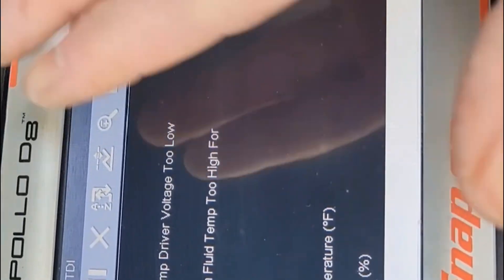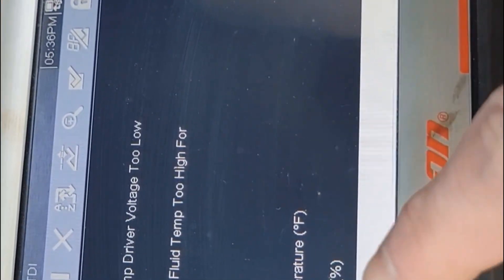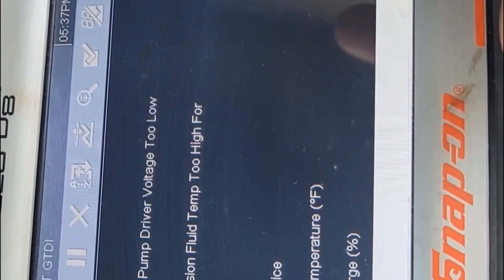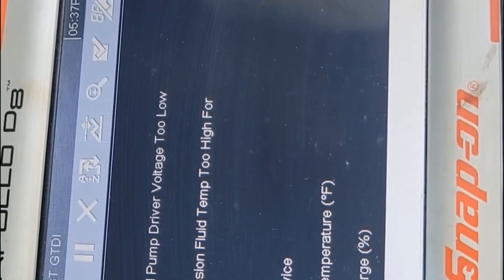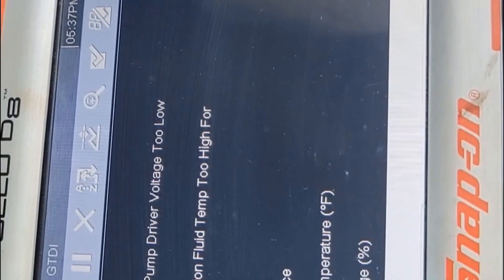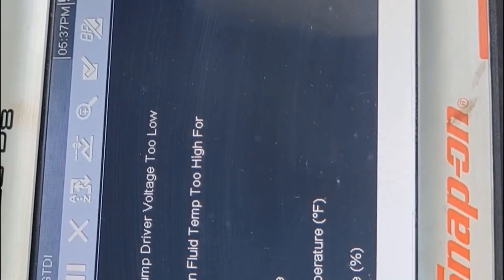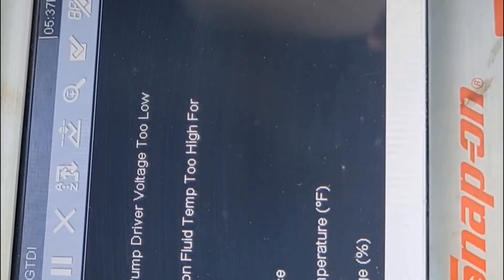The charging system is putting out fine — the battery is just end of life. So we're going to change the battery and try the manual reset method I've seen on the internet that doesn't require a scan tool. We'll verify it by checking the state of charge and days in service — those should reset to zero and around 100% if the reset procedure works.